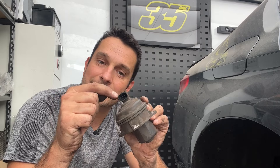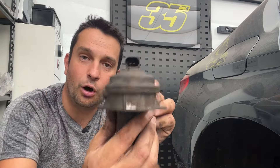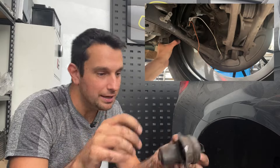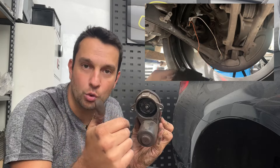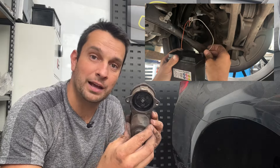You can do that to manually release the parking brake. However, if you have a spare battery, you can connect wires to the motor connector — these are 12 volts. If you connect it one way and it doesn't work, reverse the polarity. There are two small plugs in the connector, so you'll need a small adapter for the wires. Once plugged in and hooked to your battery, the motor will spin clockwise or anti-clockwise. Clockwise releases the parking brake; anti-clockwise applies it.